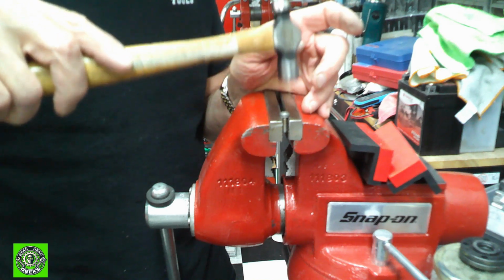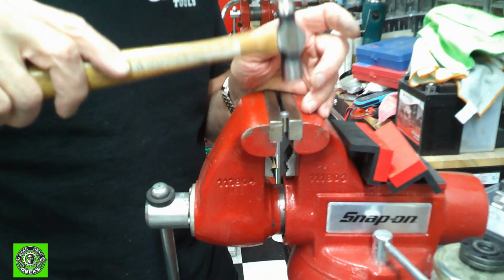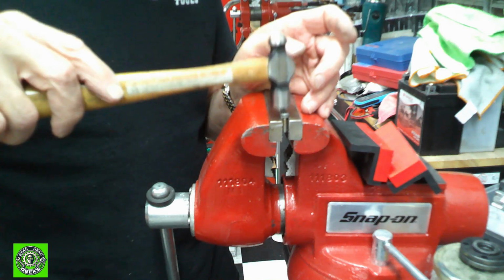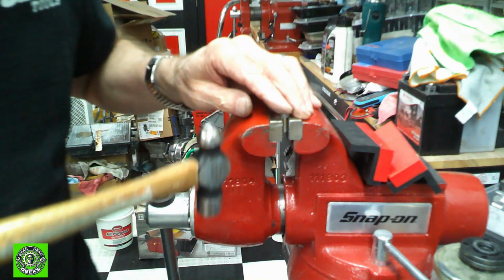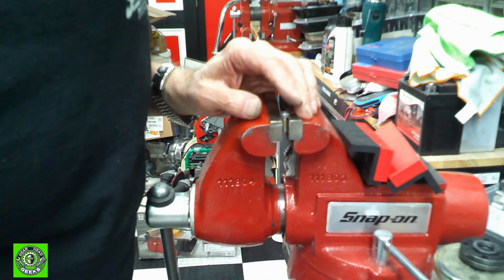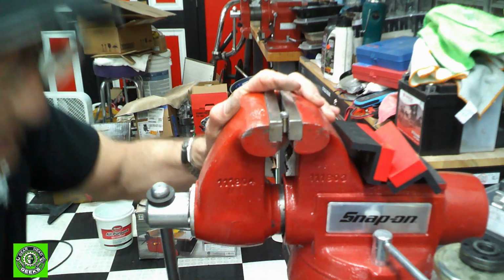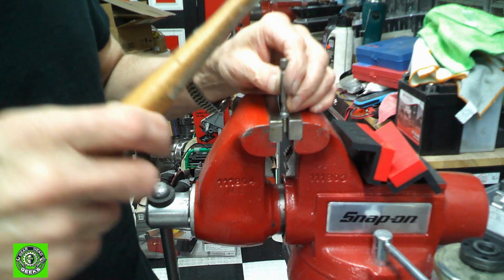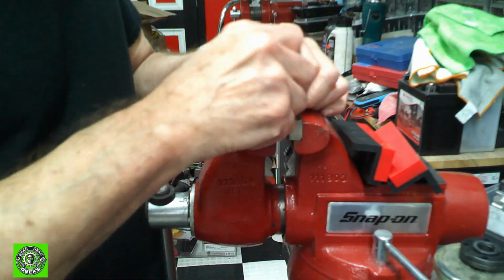And what you're doing is you're pushing the metal back down into its regular shape. Now, it's not going to be perfect, but we'll take a number 2 bit or JIS bit, whichever one you have, and we're going to reform the Phillips part of the head. It's relatively simple. Just put it in, tap it down, get it out of there,